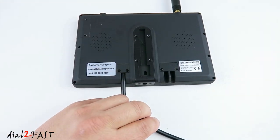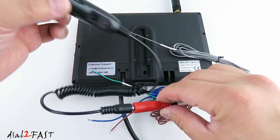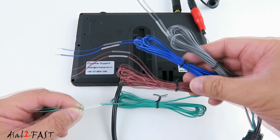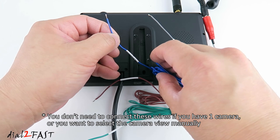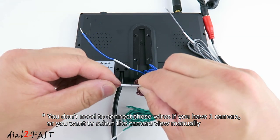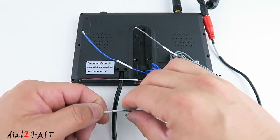Also on the back there is a cable that goes to these wires and a connector. For the power you need to connect the cigarette lighter power plug to the red connector and then plug this into your 12V accessory port. The other four wires are trigger wires for the cameras, numbered 1, 2, 3, and 4. This monitor can be paired with four cameras in total. When you apply 12V to each of these wires it will trigger the display to show that camera. For example, the blue wire marked number 2 can be connected to your left turn signal — if you have a camera mounted on the left side of the RV, when you turn on the left turn signal it will display the left camera view. The brown wire marked number 3 can be connected to your right turn signal for the right camera view. The grey wire marked number 4 can be for your backup view, and the green wire marked number 1 is for camera 1.